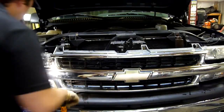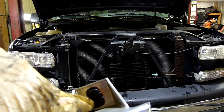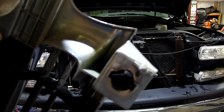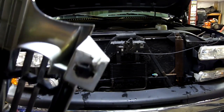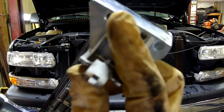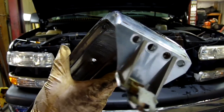You'll insert them and twist to get them to come off, then do the same thing on the other side and it will all pull off nicely. These Phillips head style clips are just a push-twist lock style — you set them into position, turn to the right to lock, turn to the left to unlock. The last thing to realize is that on either end of your grill you have little clips. Press these in with a long flathead screwdriver to remove them. If you don't, you run the risk of heavily damaging the plastic grill because it is brittle and old.